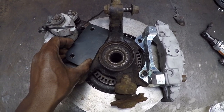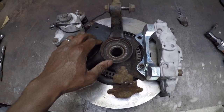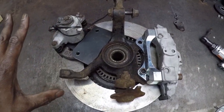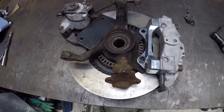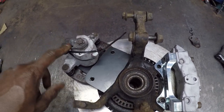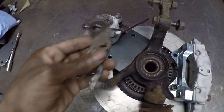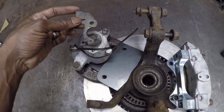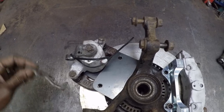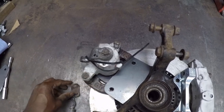The caliper now sits like so - I'll weld along those two edges as a temporary fix just to make sure everything sits where it should be. Once welded and bolted down, I can confirm the disc rotates without hitting anything, and start working out what to do with the handbrake cables. I'll need to make alterations to the mechanism because I've got to rotate it so the handbrake cable comes across the top and down - the factory position doesn't quite work for me, but I can cut and weld that.